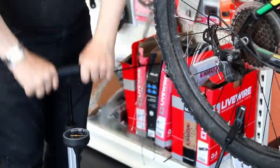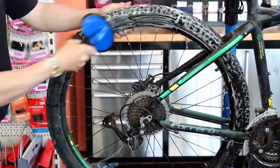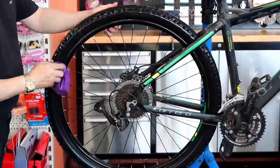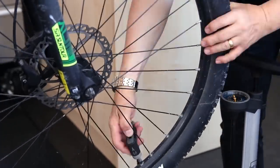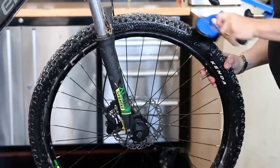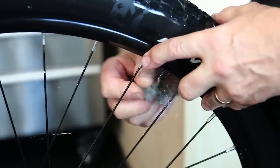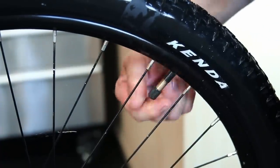When doing a job like this I always inflate the tyres first — one, I can wash them down, and two, throughout the course of my work on the bike, if there's a puncture it will have begun to show by the end of the job. In this instance the rear actually did have a puncture. The easiest time to wash a tyre is when it's on the bike on the stand because you can just rotate the wheel and scrub it down.